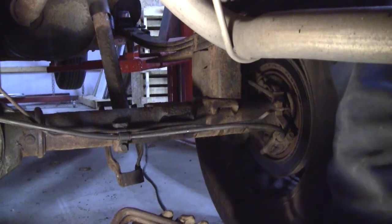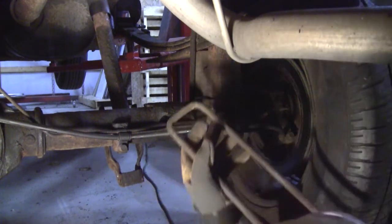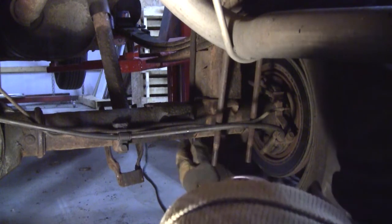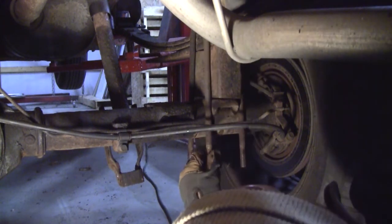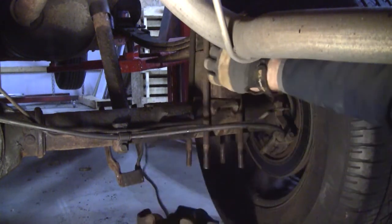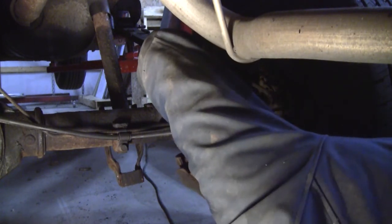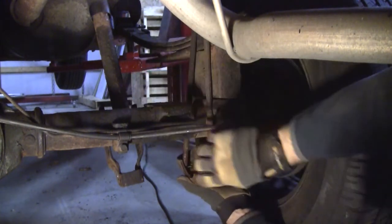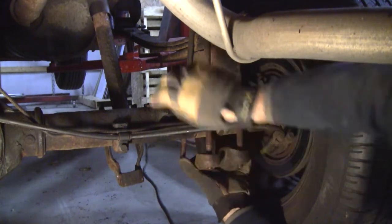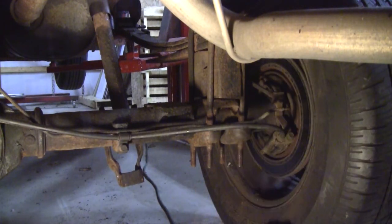So you've got to put this top plate in place. It needs to be there; you'll see it when you take yours apart. And we drop the two bolts down above. Make sure everything's where it's supposed to be. This thing should hug the axle and should hold the block in place as well. These U-bolts tend to be sprung just a little bit, so it's not unusual to have to grip them in to line them up. Like that. All right, I've got everything in place. Now all I have to do is put the bolts on, tighten her up, and we're good to go.